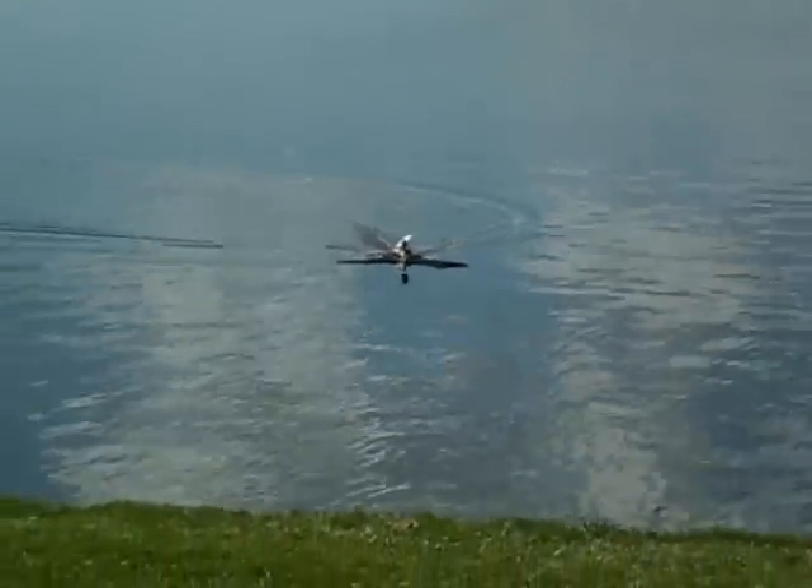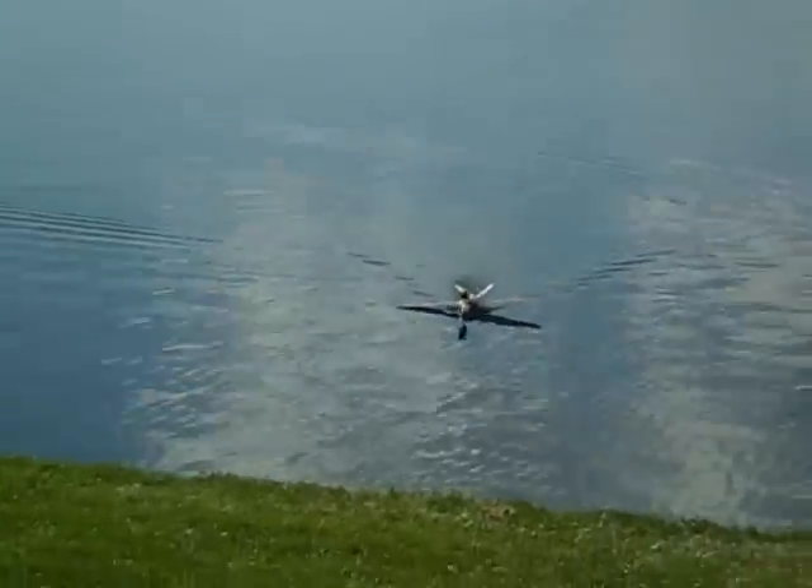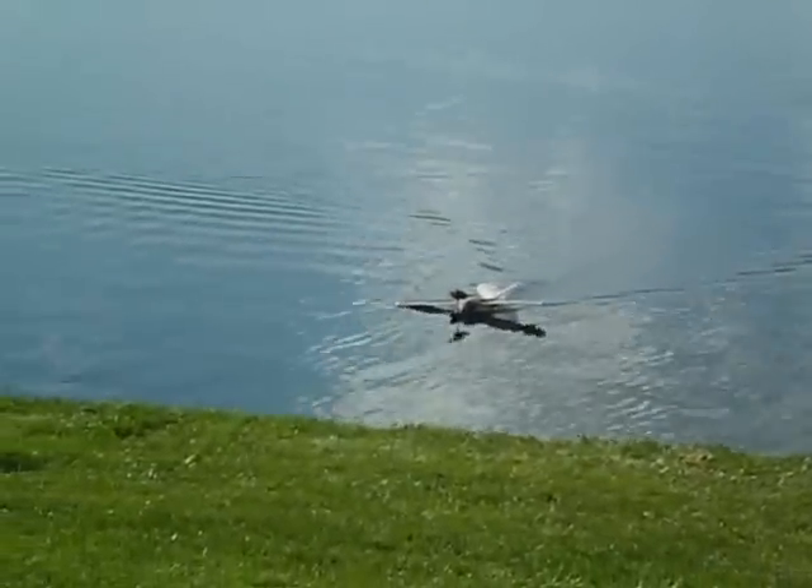The craft becomes very mushy with the aft CG and the up thrust required when the head is in the up position, but it lands just like in the first landing. Landings are very easy, and it does take off the water very easily, surprisingly for its wide body. I don't seem to have too much adhesion problems.